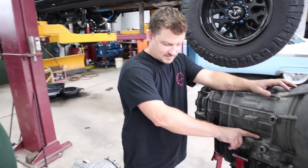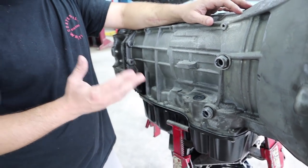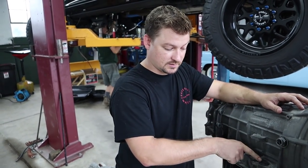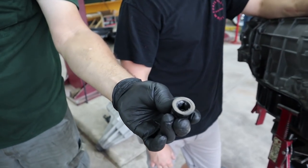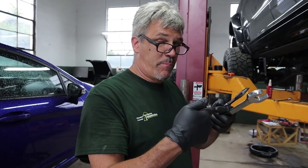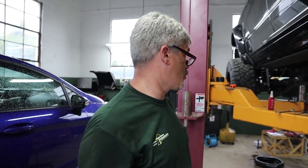Pete found something in the build room to keep debris from getting in there during transport — it covers the dipstick tube opening. As the dipstick tube goes in, it essentially pierces this membrane and we're good to go. The transmission is in, the transfer case and crossmember are installed. We adjusted a couple of bolts to make the crossmember more removable in the future. The upper control arm bolt was turned and shortened so it can now come out without interference — everything else is buttoned up.